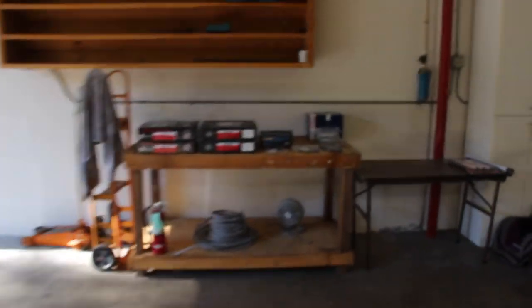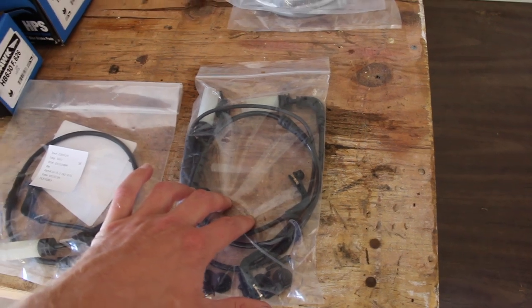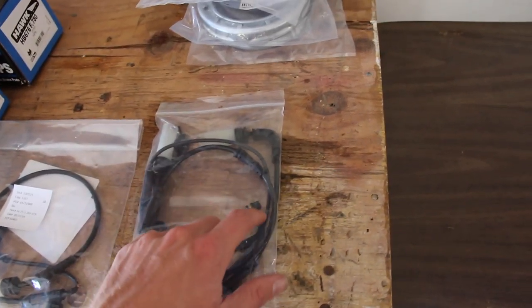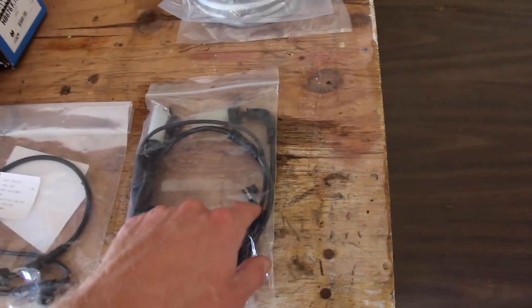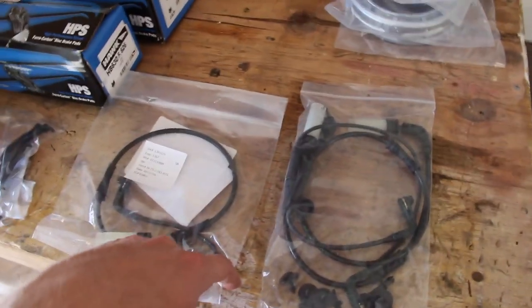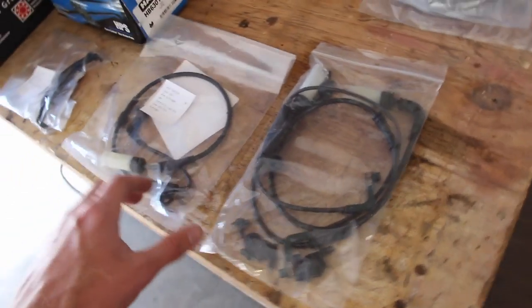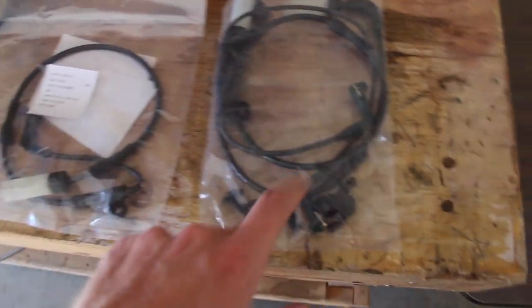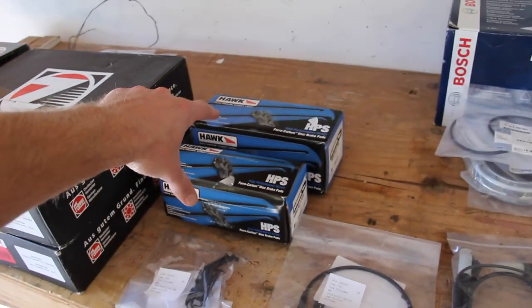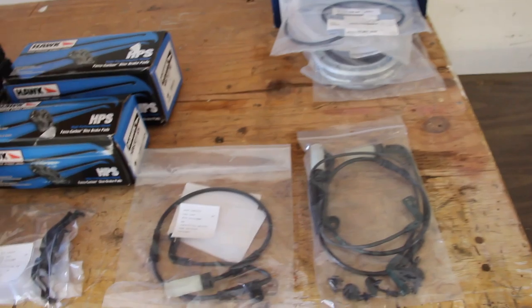You should also be doing the brake pad wear sensors. Even if they haven't tripped the indicator inside the car, it's just good practice to replace these things. The plastic gets brittle, sometimes you'll lose the contact. They're cheap - just replace them. According to Real OEM, there are three: one on each front wheel and one on the rear axle on either the left or right. So that's it: four rotors, two sets of brake pads for front and rear axle, anti-rattle clips, and three wear sensors.